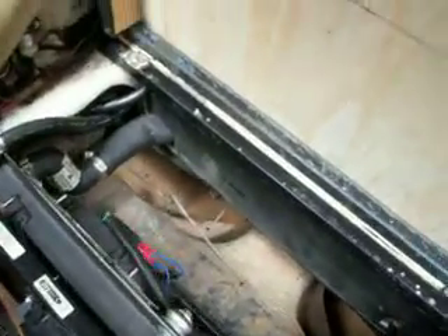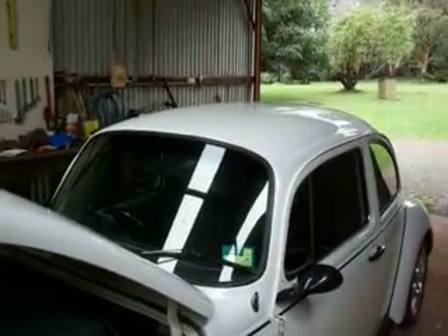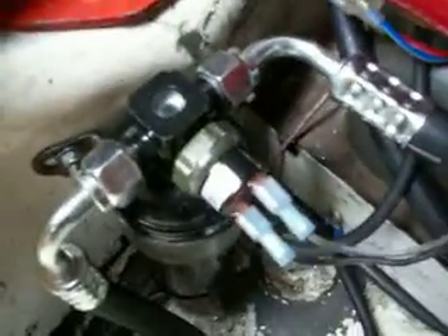The pipe work runs just under the sill with my coolant lines up to the front where my condenser is. The condenser is just a J-Air universal replacement for a Mitsubishi Express van or Star Wagon standard wheelbase — they've got triple the interior space of a Beetle interior, so that's not even breaking a sweat. It's got a universal dryer with a sight glass and safety pressure switch, and a J-Air universal evaporator and fan in that enclosure, ducted the same as the Super Beetle system — return air through the glove box and supply through the fresh air box.